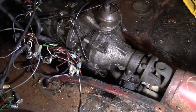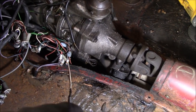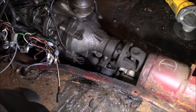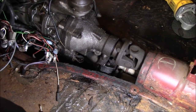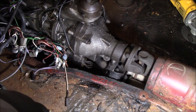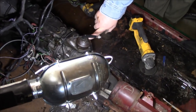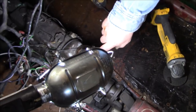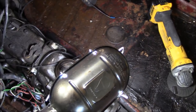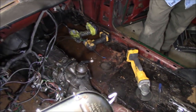This car was not originally fitted with the overdrive — it was an aftermarket overdrive. This is a J-type overdrive; I can tell by the bottom rectangular piece — it's not an A-type, which would be for an earlier car. This operates in third and fourth gear overdrive. It's actually pretty clean. That's just the shift pattern plate — that's the shape of it.